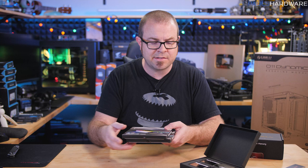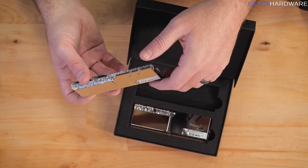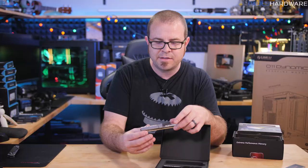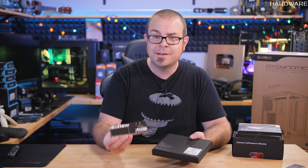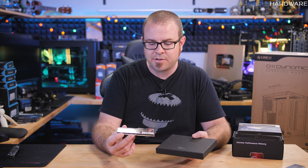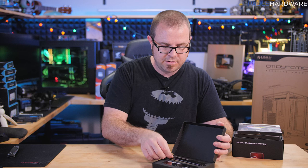Finally there's another Royal kit from G.Skill - same memory underneath, but with a very shiny finish and a fancier faceted RGB topper. This kit is DDR4-4400 at CAS latency 16-19-19-39 at 1.5 volts, so this is an overclocking kit. If I'm ever putting together a setup and want the fastest memory for gaming or whatever, I can pop this kit in and get some really nice speeds. That rounds out my final package from G.Skill - a huge thank you to them for their support.